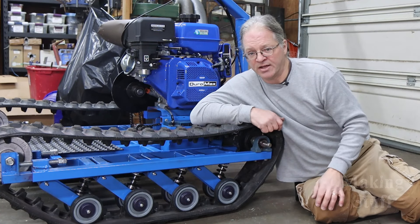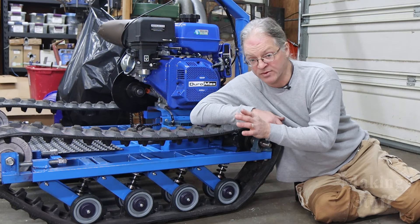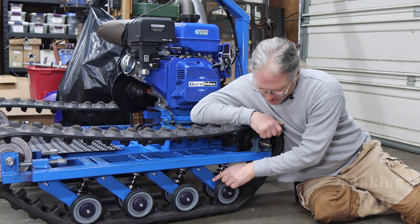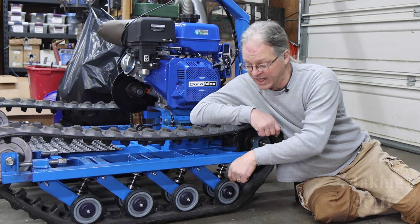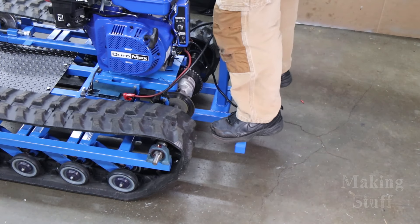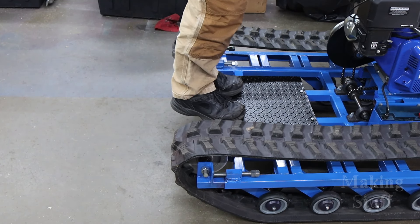The first thing I had to do was fix that nosedive issue because it was keeping me from being able to ride this machine, and it turned out to be a much more simple fix than I thought. All I had to do was move these bogey wheels forward about six inches by rotating the bogey wheel assemblies so they face forward instead of to the rear. That got it really balanced out — I can stand on the bumper and it won't nosedive, and I can stand on the rear and it won't pop a wheelie.